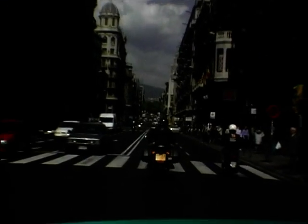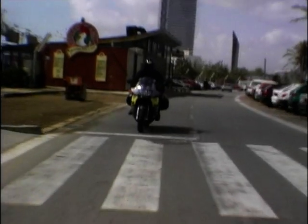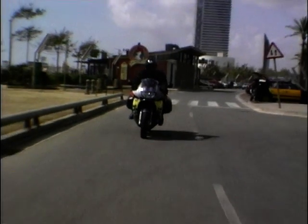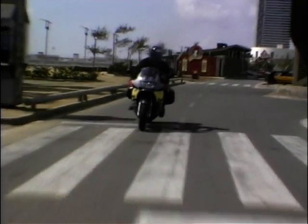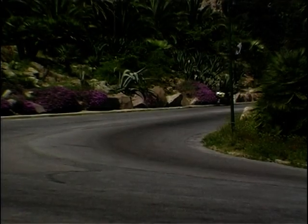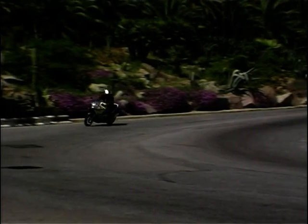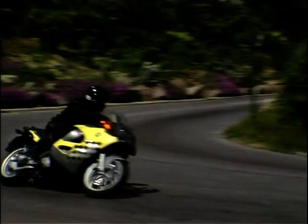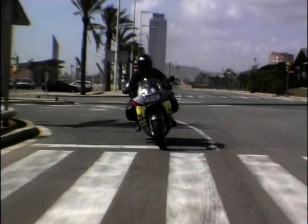The new 1200cc engine is a stroked and lightened version of the well-proven K-Series inline 4. With 16 valves, fuel injection and electronic ignition management, it produces 130 brake horsepower at a fairly conservative, but heady for BMW, 8,750 revs. Mated to a new 6-speed gearbox with a slick positive action, this is a wholly different sort of BMW. If you're after a top-speed rocket ship, there's plenty of other bikes to choose from, because this one, with torque increased by around 10%, is more in the intercontinental cruise missile class.